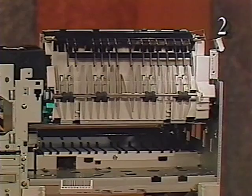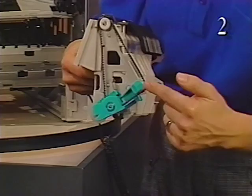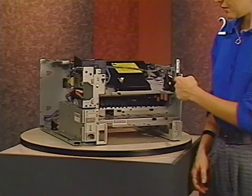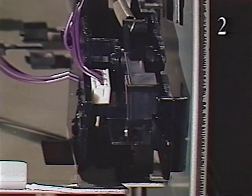This is the delivery roller assembly. The delivery roller assembly moves the page from the fuser assembly, following a C-shaped path, to the paper delivery tray on top of the printer. The assembly contains three gears and a gear drive belt, which are driven by the fuser assembly. Here are the delivery interlock sensor PS-201 and sensor arms, the last parts to be identified. This sensor performs two functions. First, the lower sensor arm, when activated by the sensing lever housed in the fuser assembly, establishes that the printed page has cleared the fuser assembly. If the sensor arm is not activated within the prescribed amount of time, a delivery unit paper jam is determined to exist.